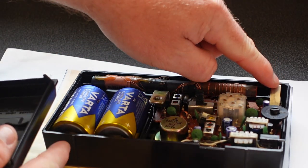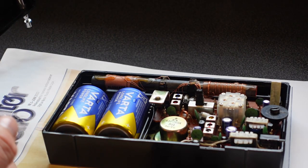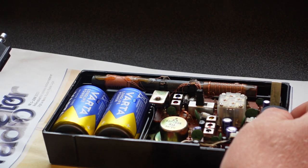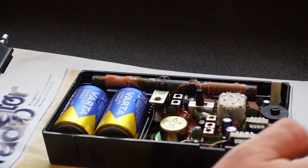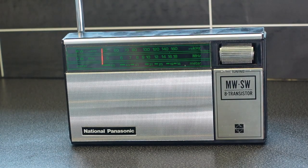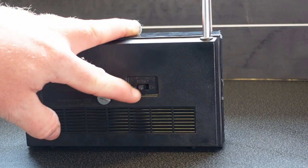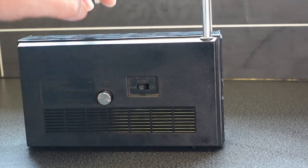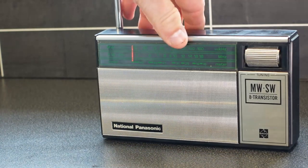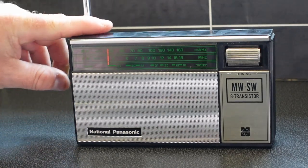You can see here this small tab here matches the antenna, so in order to see if there's any audio I probably will have to do that, but we can just see first. There is sound, so let's just pop this on loosely and see if it works. So now it's time just to see if there's any life in this one. We heard that there was some sound, so probably at least the receiver is good, but we don't know if it receives anything. On the back there's a switch for medium wave and short wave — I put it to medium wave, and let's just see what happens when I turn the volume knob.